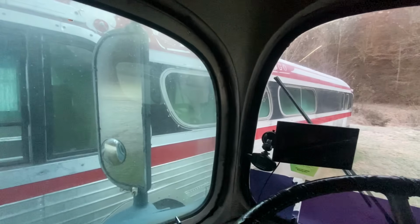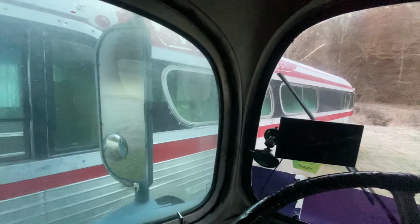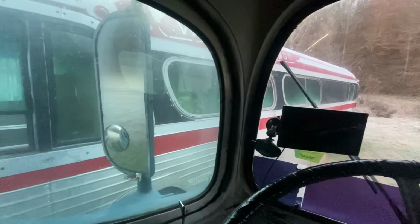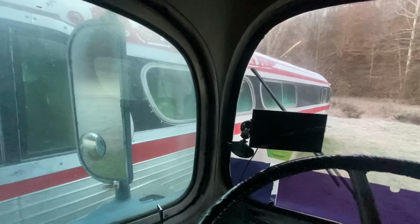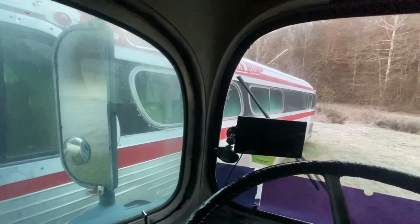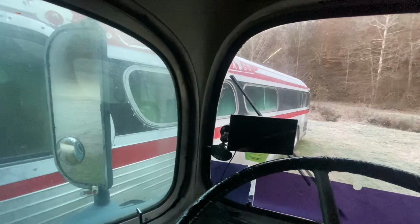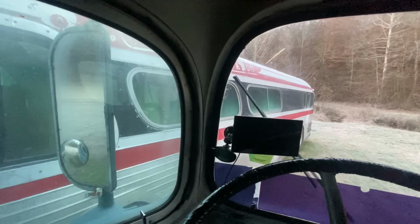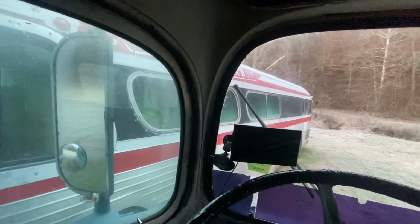We got an extra airbag if there is an airbag down, but the bags in the front were all hard, and those are all plumbed on one thing. So if there's one down, it's a rear, and neither side of the rear ever came up at all. So it could be 2 airbags in the rear, I'm not sure. But I know that it's not building air because of that massive air leak up front by the brakes. So once I figure that out, we'll go from there.